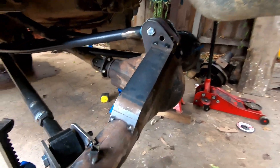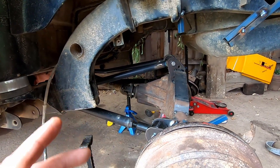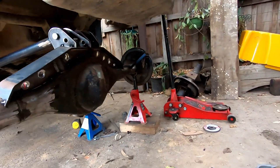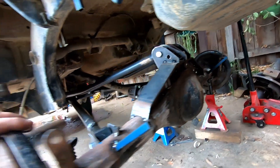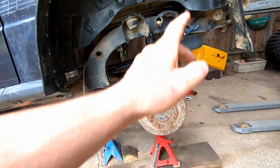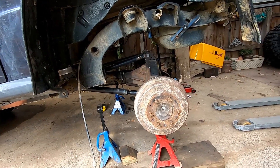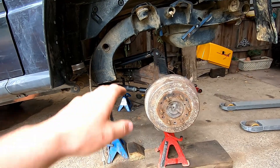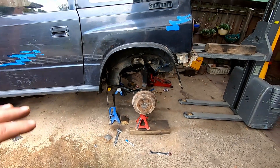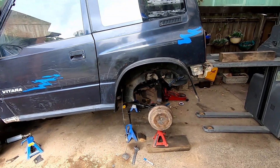All tacked in — came up really well, I'm pretty happy with it. It's pretty satisfying when what you envisioned in your head becomes reality. All the holes and whatnot on the diff truss look really good. Now we can start measuring our shock lengths and what's going to work with tailshaft angles, because if our shock is too long you don't want binding in your rear unis. What sort of sucks is the tailshaft is quite short, so we're not going to be able to get the most amount of travel.